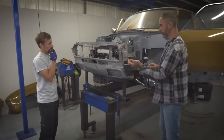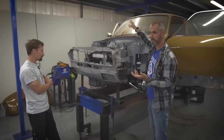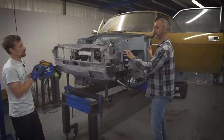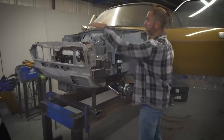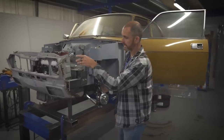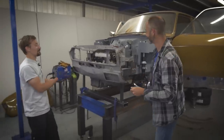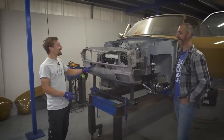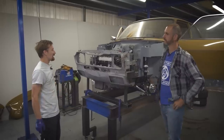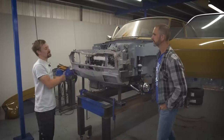The bonnet is going to stay as a conventional hinged bonnet with hinges here, maybe gas struts. The front panel will be attached to the wings and will be either hinged or quick-release as one — so two wings and front panel off together. We're trying to keep as much of the original paint as possible, which is a headache, especially since some of the car already needs painting. We'll have to blend the new with the old — as long as the majority of the original paint stays. It's really just the very front and very back.